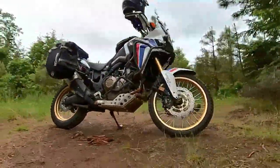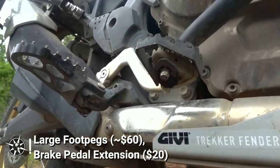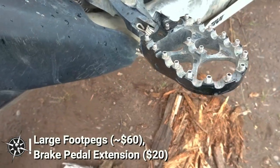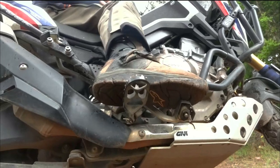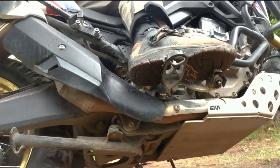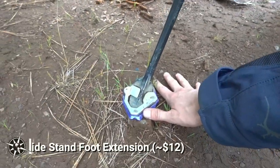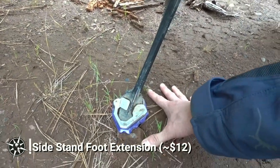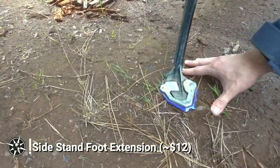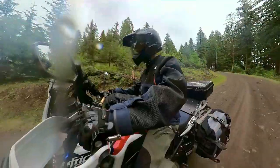A few more budget-friendly eBay finds for improved controls: larger foot pegs for around $60, and a brake pedal extension for around $20. The foot pegs are great, providing a much more comfortable platform to stand on during long days of off-road riding. The enlarged brake pedal is also nice, as I find I don't have to hunt for it as much with my toe when standing or sitting. I also picked up a side stand extension that bolts right onto the existing side stand. I would like it to be a little bit bigger — it would be better for super muddy and sandy areas — but for $12 I really can't complain too much. Just make sure to install it with a bit of Loctite, as I've heard they are prone to vibrate loose and fall off.